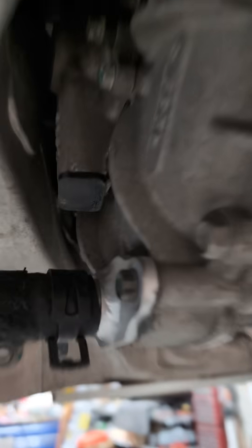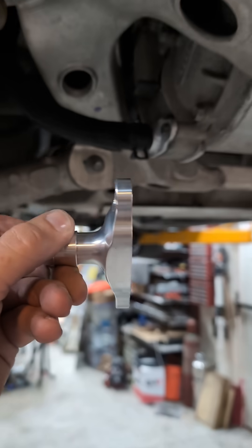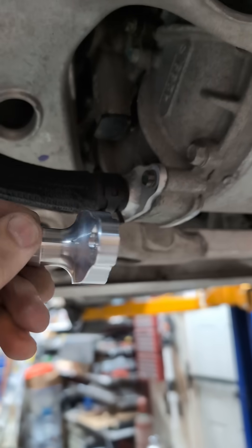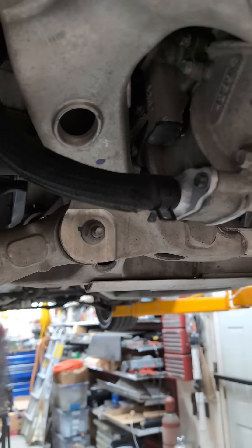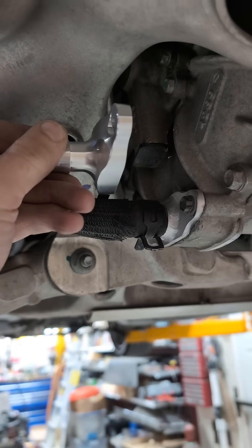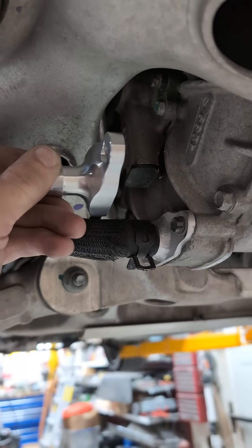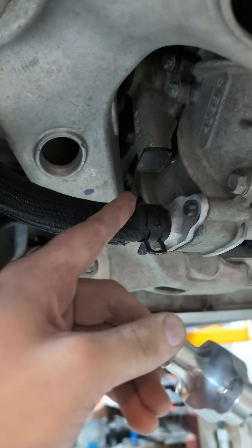Hey, just a quick look at my Plymouth with the Tesla Large Drive Unit and the Model S Coolant Delete Kit. My kit can be installed in the car without removing the drive unit — no need to deal with corroded high voltage cables or drop and disconnect everything. You just cut off the coolant manifold where you want to cut off flow to the rotor where it leaks, and we add this billet aluminum fitting in place of the OEM plastic fitting.